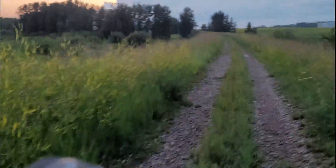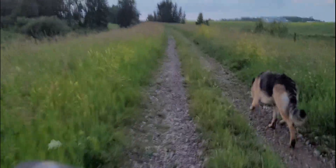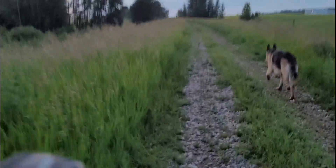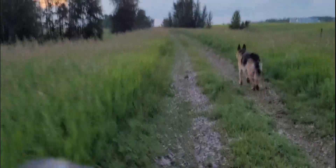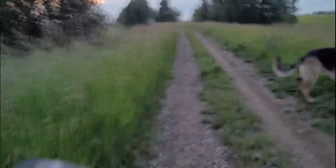It actually feels a lot smoother in the high gears now — on the 11 tooth it's super smooth. I think it's pretty good; I don't think I need to change anything. I can probably just loctite it on and drive the bike. The Luna Eclipse 42 tooth works pretty good on a Giant Trance 2012 with a 92 millimeter bottom bracket. It's a good purchase — I can tell already I like the improvement. Thanks for watching.